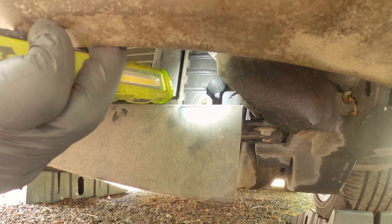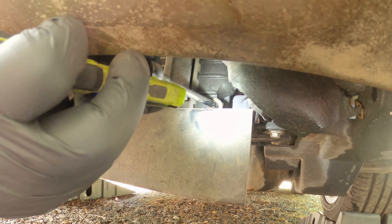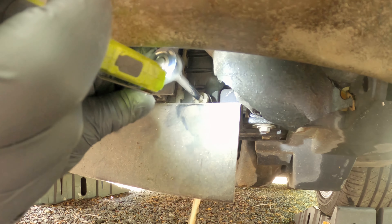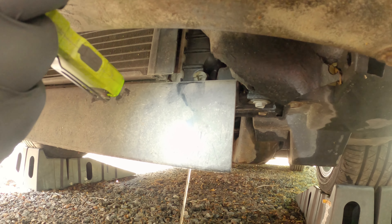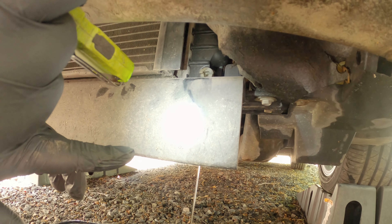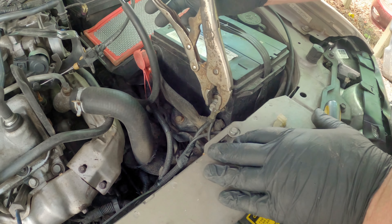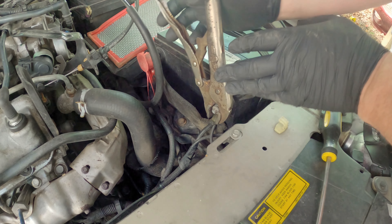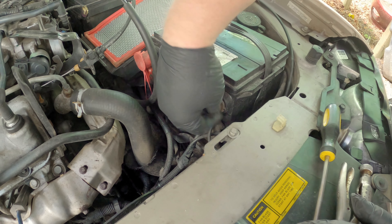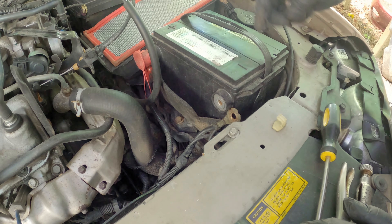Down under the car on the radiator facing the front of the car, you're going to have a little drain cock right here that on this one is quarter-drive sized, so you can just use a quarter-drive extension. Turn this back out and when you back it out just a couple half-turns it's going to start draining coolant. Then go open the radiator cap so there's plenty of air to get back in so it'll drain fast. Also, first thing you need to do before you do anything is disconnect the battery - this one is rounded off so I'm going to have to use vice grips, but we'll replace that lug before we're done. Once that's disconnected so you don't have to worry about making any sparks, we'll move on.